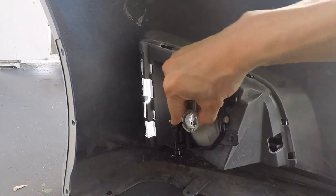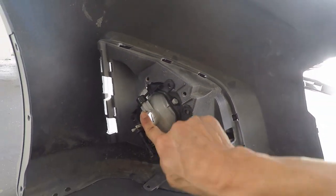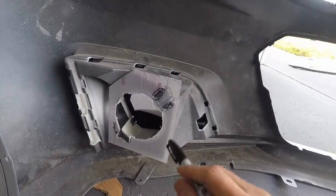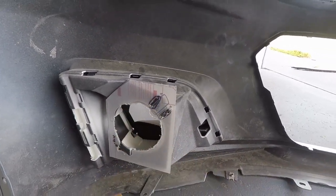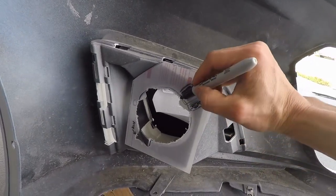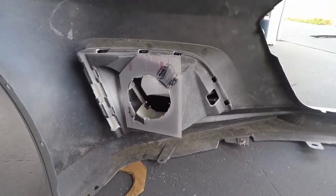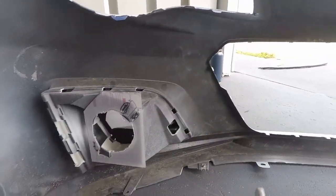The brackets are generic and don't line up to the three factory holes on the BRZ bumper. I just finished cutting the plastic piece — this is going to be the mount for the lights. I think I have to trim a little bit more around here, and then those will mount to there. Once I make sure it works 100%, I'll flip it over and make another one for the other side.